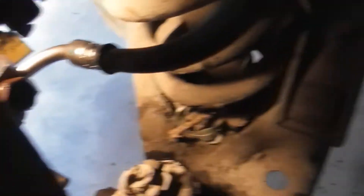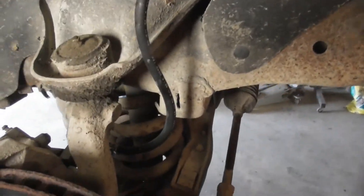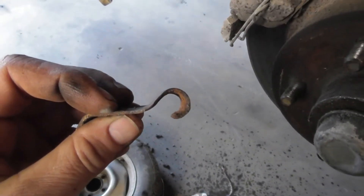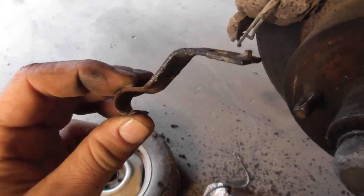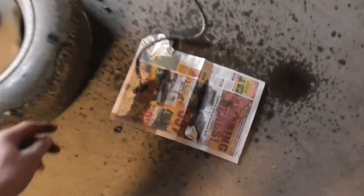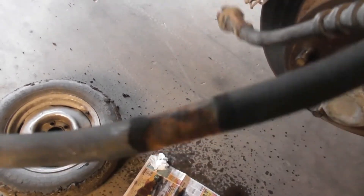I loosened the bolt back in there for the hose, and as soon as I did that, it released. And it did not lose any brake fluid out of the hose — it should run fluid out of the hose when you unhook it, but it didn't. So that would be the culprit. That metal bracket clamped around that hose for years and years — I'm assuming they're the original hoses to the pickup — and it squeezed her down. You can see that's squeezed down pretty good.